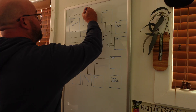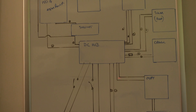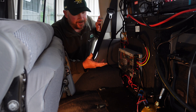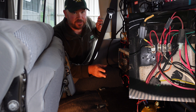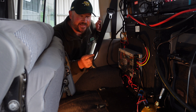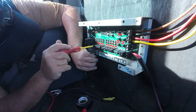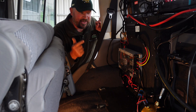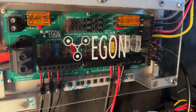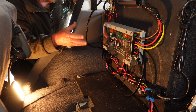I find this a little bit daunting because I'm playing with a different sort of voltage setup and designing it myself. But one key thing came to light when I started researching, and that's the Egon DC Hub. On any other installation there's generally going to be a lot of wiring, a lot of bus bars, a lot of fuses all scattered around the place. But what this does is make it easy to understand even for the most novice installer — it brings everything, all of your 12 volt system, back to one place. It cuts down on wiring, makes it easy to install, saves you time, and it looks schmick — like a really professional job.